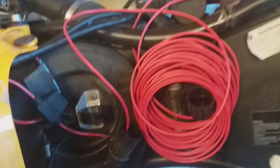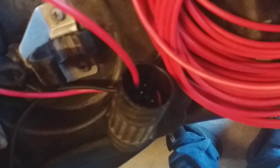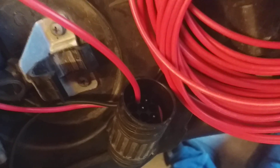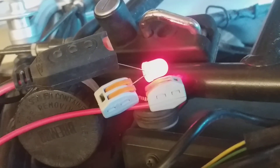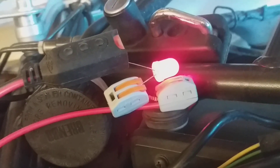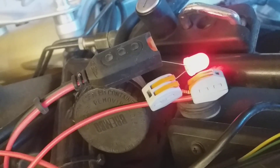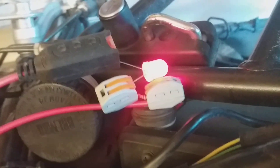What I did was hook into port number 2 on my diagnostics port, and then a bunch of wire. I have a small LED with a 1.2kΩ resistor. That's hooked up to the positive lead on my battery. So I'll turn the ignition on and see what happens.